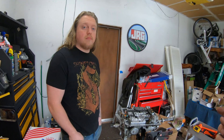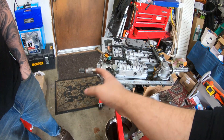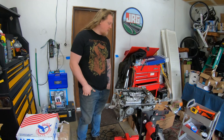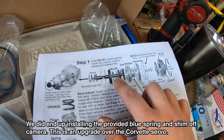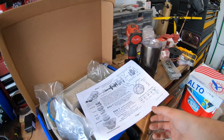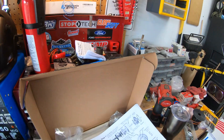Like the two to three shift, three to four, and kick down — downshifting. We might tear into it. Like I said, it's not the end of the world if we had to take it back out. We could probably save the gasket for the pump, but worst case we just buy a new pump gasket. Transgo is always incredibly descriptive with everything. We already put that Corvette servo in, so the only thing they request you replace is that blue spring — actually they want you to put their spring inside the other spring, so even more spring force, lots of engagement. It'll slam you in gears. The servo is one of the problems with the band disengagement, so we'll decide — we might pick and choose, but we might do all of it.